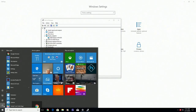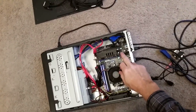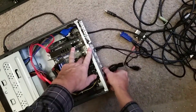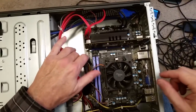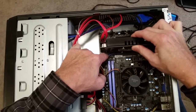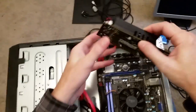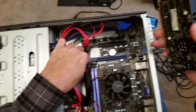What I'm going to do is get the computer shut down and deal with the face plate issue. At the moment the video card is in there and working, but there's really nothing holding it in place — I can just use my finger and move it. To take the video card back out, there's a little tab you pull down on, which allows you to then lift up on the video card. Otherwise this little piece of plastic won't allow it to come out — it's a way to secure the video card in place.